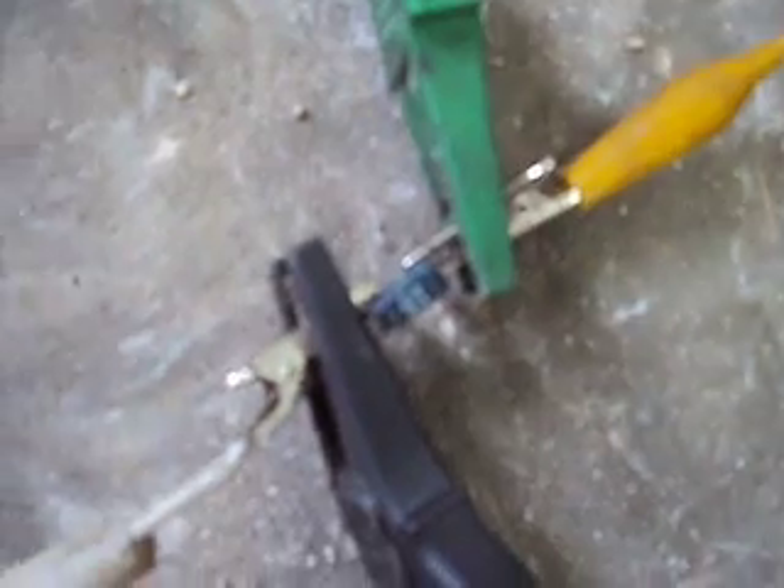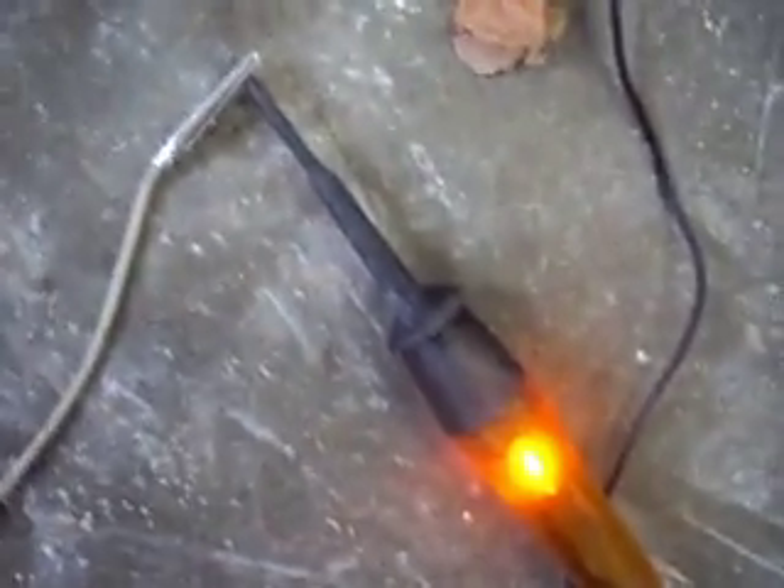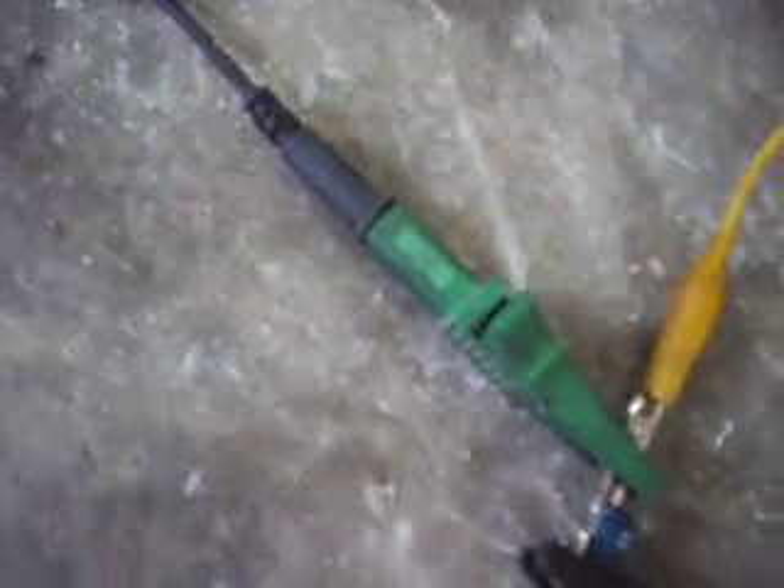The point of the test here was to see if — I've got my Vantage set up on millivolt. Right now it's registering one millivolt, and I've got the test leads one on each side of the fuse. The point was to see if you could measure parasitic draw through a fuse on a loaded circuit by measuring the voltage drop on each side of the fuse. I'll show you what happens — we're showing one millivolt. I'll disconnect from the battery, the power source, the light goes out, and we drop down to zero. Hook it back, and it comes back up to one millivolt.